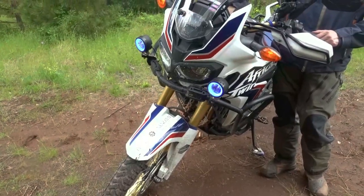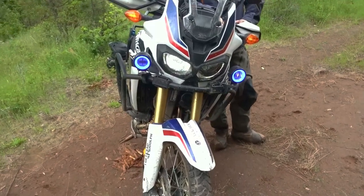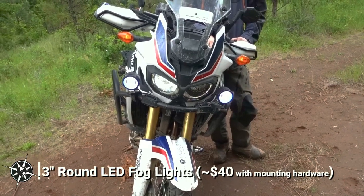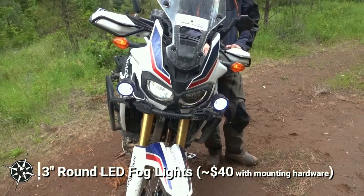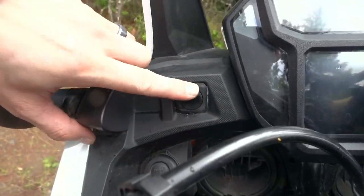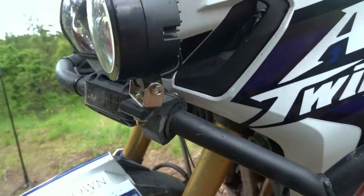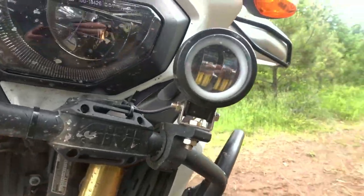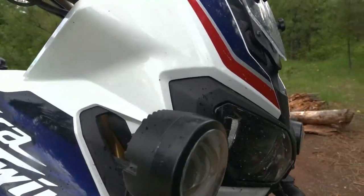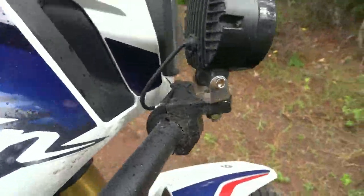Improving motorcycle visibility is also extremely important to me, for both on- and off-road safety. These 3-inch round LED fog lights include beautiful blue driving lights that I love. Now often with inexpensive lights you get what you pay for, but so far these lights have performed well and only cost around $30. I've wired the running lights to be always-on, with a 1-inch switch mounted in the dash used to activate the spotlights. Because these are just simple lights, some advanced bike electronics and wiring knowledge is required. The light mounting brackets I'm less impressed with — these have been prone to stripping out, and at only $10, they were a great deal, but I'd look for something a little stronger next time.